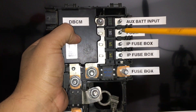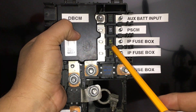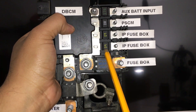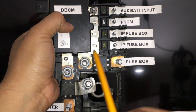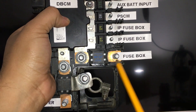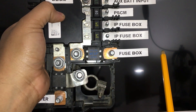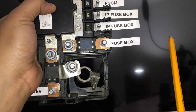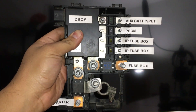I say accessory load, but this includes all kinds of things — pretty much all of the electronics: anything involving powertrain management, air conditioning, power steering control module — pretty much all electronics other than the starter motor are attached to this pad. Up here we have an 80 amp fuse that feeds the power steering control module. Over here a 60 amp fuse feeds the fuse box at the instrument panel, and another 60 amp fuse feeds the other instrument panel fuse box.